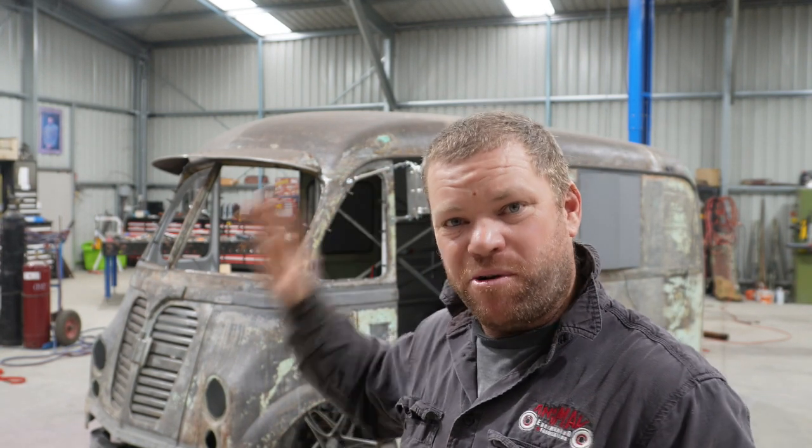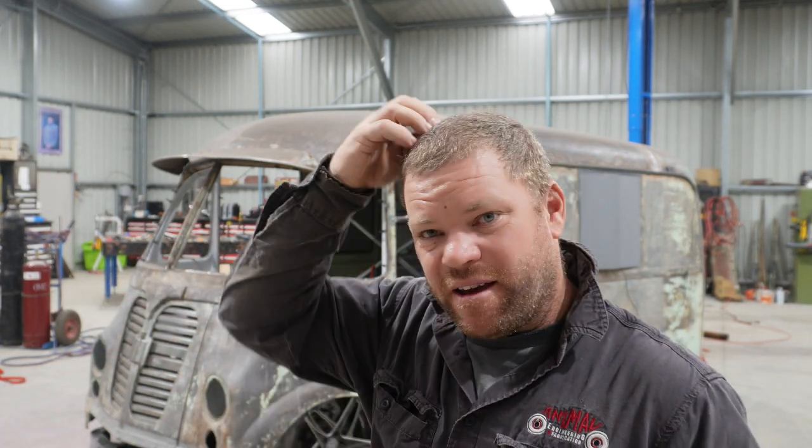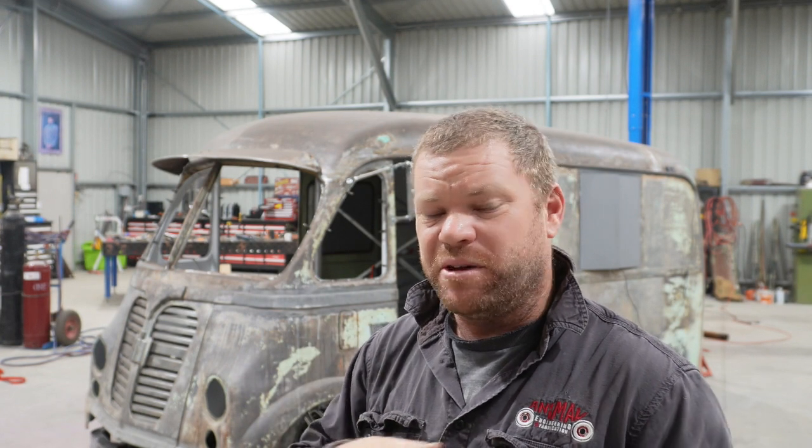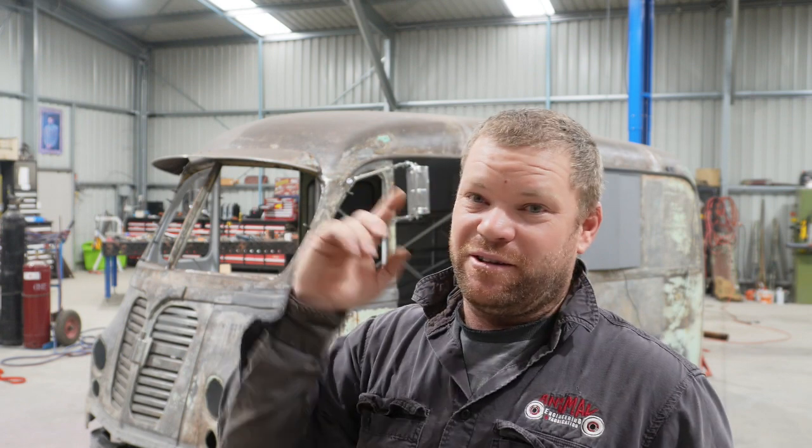Now I'm just going to put the body on and looking at getting it squared up on the van and all that kind of jazz, and I've realised that I probably realistically should do a wheel alignment first, because it could just be completely all over the place, and at the moment the front wheels are just touching on the guards, so I want to make sure that my toe and camber are correct because it could prevent a lot of work.